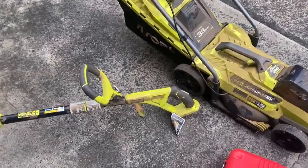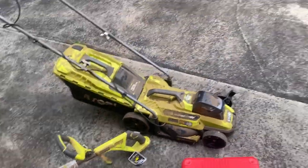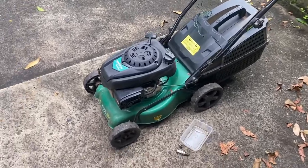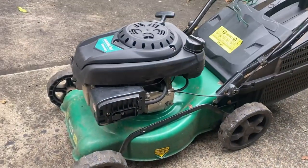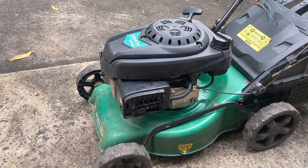This line trimmer is so new it still has the tag on it. Anyway, not much more has drained out of the mower - it's mostly just clean oil. A little bit of moisture there, but I'm going to fill it back up with oil and just give that carby needle and seat a clean out.